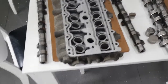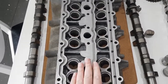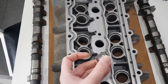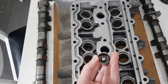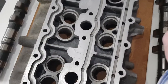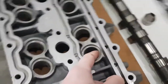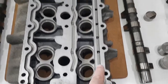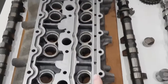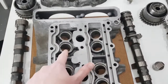In terms of the other parts within the casting, these are the actual tappet chests — I've got them upside down just to show you the differences in machining on this side. The tappets themselves: this is one of the GT3 ones; as you can see it's domed and it's a hydraulic one. These weigh 29 grams, so very lightweight. For oiling, there's a little hole and an oil gallery across here, and this drilling feeds oil to these six tappets along here.